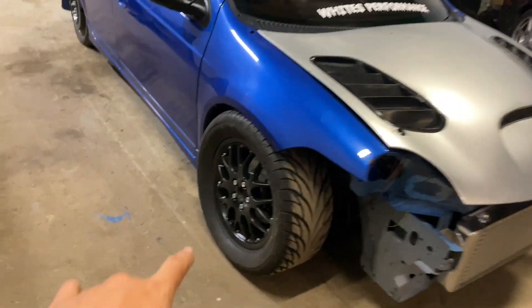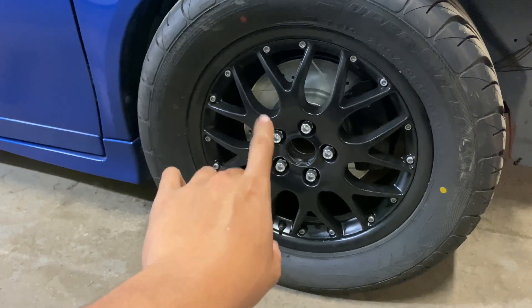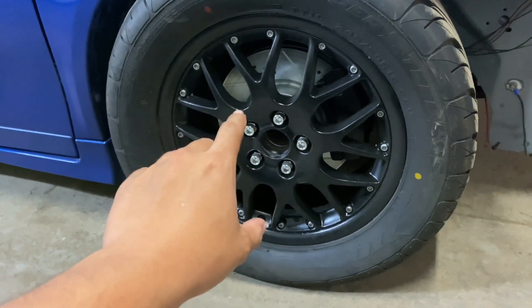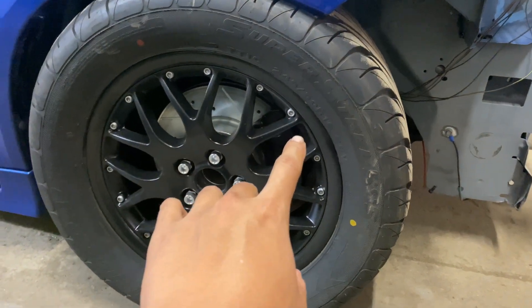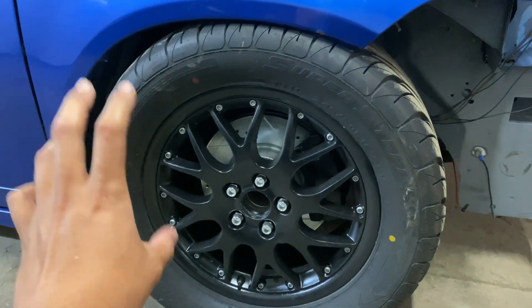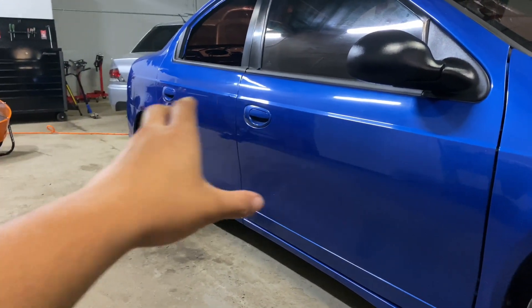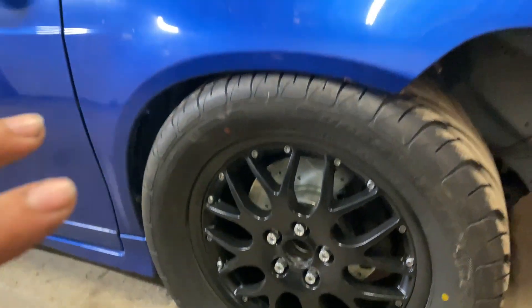I also picked up these BBS wheels a couple weeks ago from a Volkswagen — these are real two-piece BBS wheels. When I got them the paint was all cracking, so I ended up sandblasting them, repainting the hardware, and redoing the whole entire wheel face. I also have brand new pads and rotors all the way around, and the tires are 245/50/16 Federal RSRs. I know these aren't going to grip very well, but it's just something to get the car rolling on the street. When I put the rims on, they sat inward — the typical hovercraft look for SRTs in the rear — so I have a one-inch spacer I need to get for the rear so they sit flush.